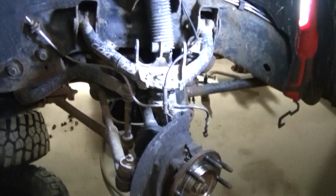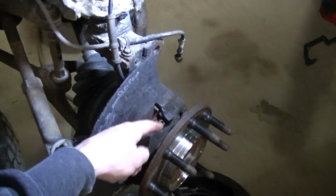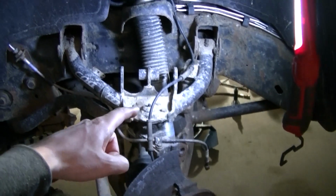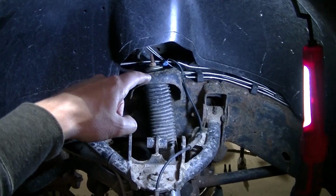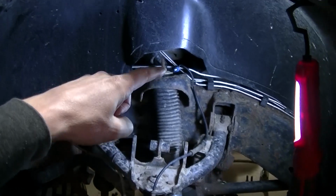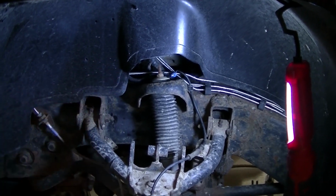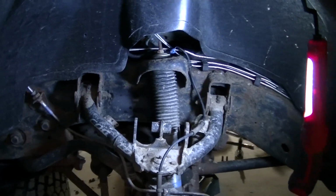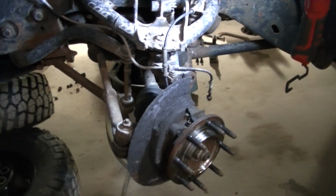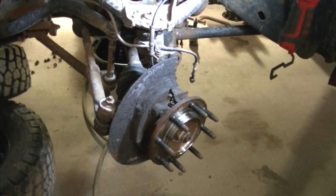So I've got this side tore apart. I replaced the ABS sensor on this side, but it looked good. So I'm thinking it might be this plug. When I unplugged that, it kind of looked cruddy. And I think maybe I might have got brake fluid in there when I did my brake lines, and it might have done a little bit of corrosion in there, caused the trouble. We'll see, I guess. Once I get this all put back together, I'll know.